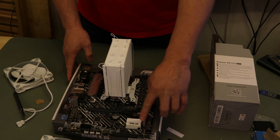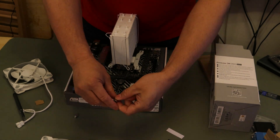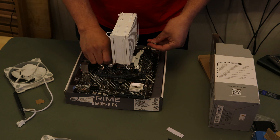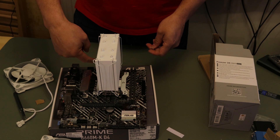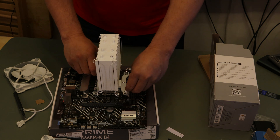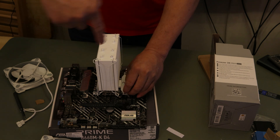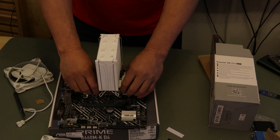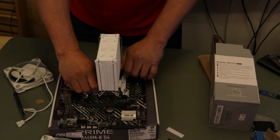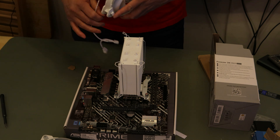Got it going that way, same label as Asus. Then you finish off with these thumb screws. Tightening the fan down. I've not pasted it because as I said I might be using this fan somewhere else, so there's no point wasting the paste. When you do the front thumb screws up, make sure you go crossways.